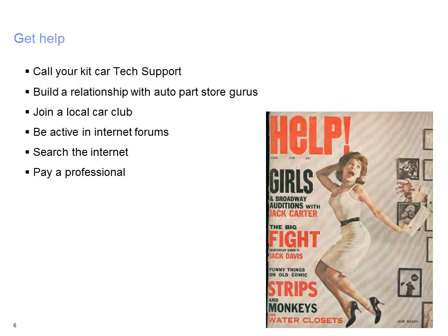That doesn't mean you can ask these people to come and do your kit for you and spend a lot of time, but you'd be surprised how just sitting around having a beer with them after a club meeting and talking about what kind of problems you're having, they might have a little piece of advice that can really help you. For example, I had a little leak coming out of the end of my transmission, right where the drive shaft yoke comes into it. And come to find out there's a little cap that can work its way loose there that I never would have known about.